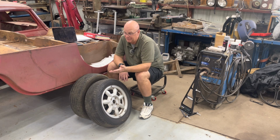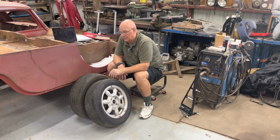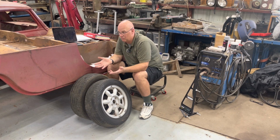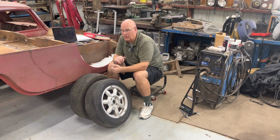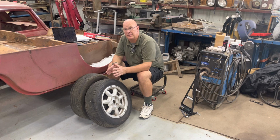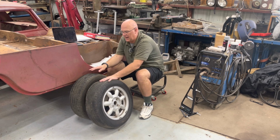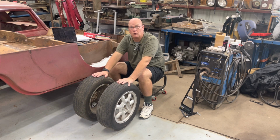When I was autocrossing, sure enough, it was skidding like crazy. So the Porsche needs 1.5 degrees, maybe 2, to make it so when you turn the wheel, it's going to turn right now. That's something you have to decide. You're doing alignments. If you go between 0.5 degree to 1 degree negative camber on the front, you should have a pretty good road and fun track day front camber.